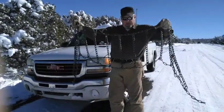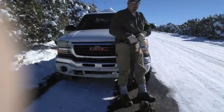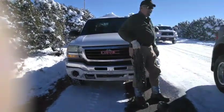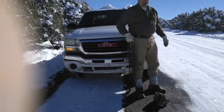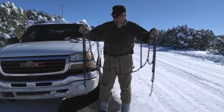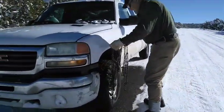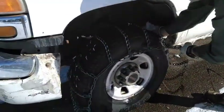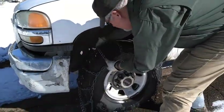I'm going to take these chains and get it about halfway. We're out here in the road doing this so the video will work out. We had a little interruption with some traffic. We still have the chain the same way — quick link to the inside and the open part of the hooks to the outside of the tire. We want to get it somewhere near the middle and just come up here and drape this over the tire, making sure that it's straight all the way around. You want to have about the same distance overlapping on each side.